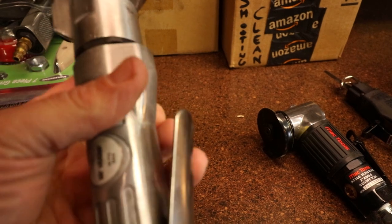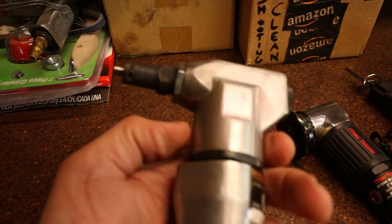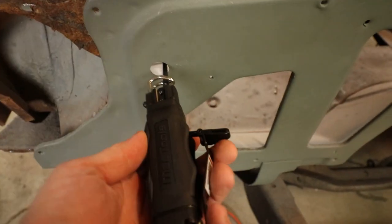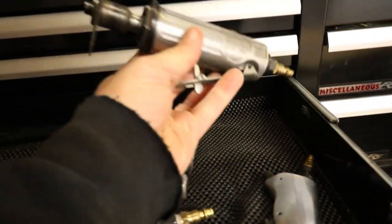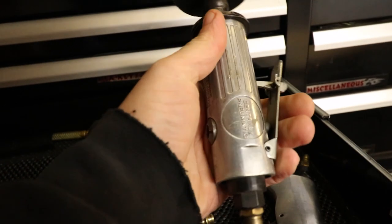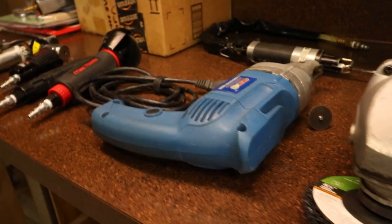This is a nibbler — actually a really good tool, but I got this thing at Harbor Freight a long time ago and it could not cut a straight line if its life depended on it. You have this little Mac cutoff wheel — this thing works really well. Then you have the reciprocating saw, also called a saber saw — those work really well, you can really get into tight spaces. And you have your good old-fashioned cutoff wheel. Now I know I knocked Harbor Freight there, but I bought this thing on sale for seven dollars and I have been using it for over ten years — it is my go-to cutoff wheel. Sometimes you luck out and get a gem like this. If you're interested in any of these tools, there will be a link in the description for most of them.